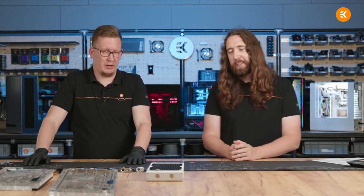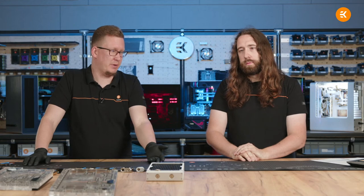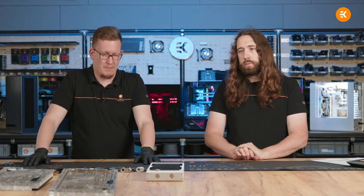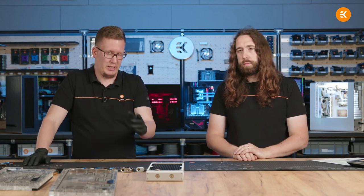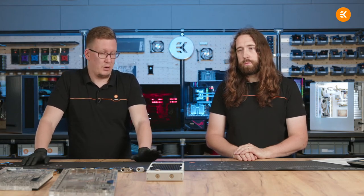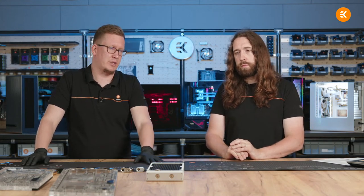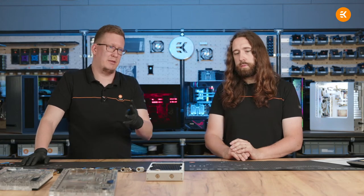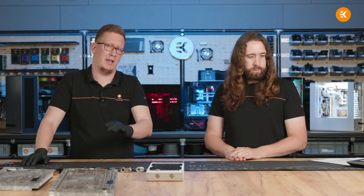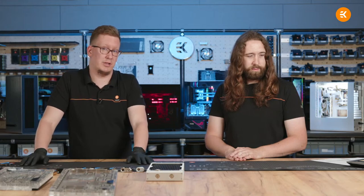If you check reviews of the Coolstream XC, even today, they are the best performing radiator there, so there wasn't much place to improve there. Also, like Joe mentioned, the best all-rounder is the P. All of the P radiators are multiport radiators, which means they have five ports. Four ports can be used for making your tube runs, and you have an extra port on the other end of the radiator where you can either bleed air or just install a drain valve.